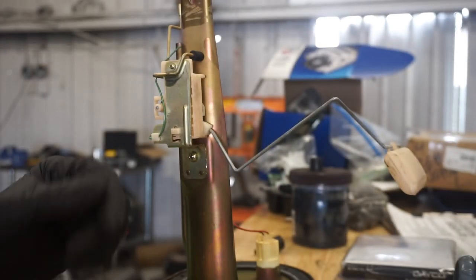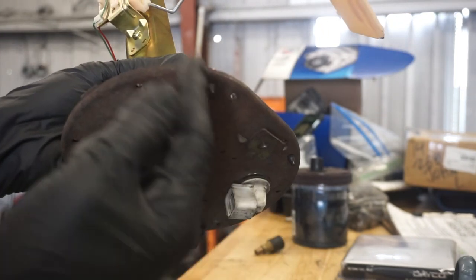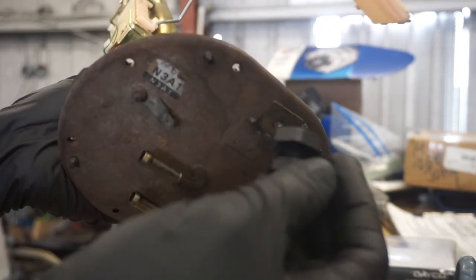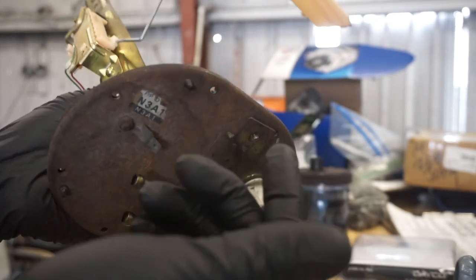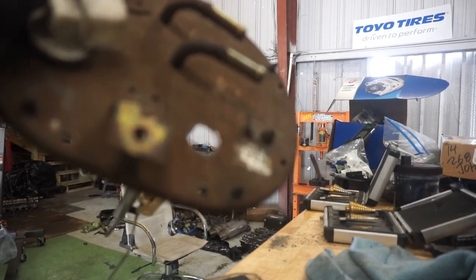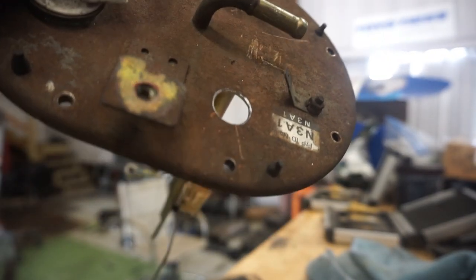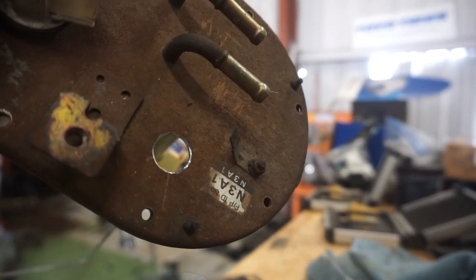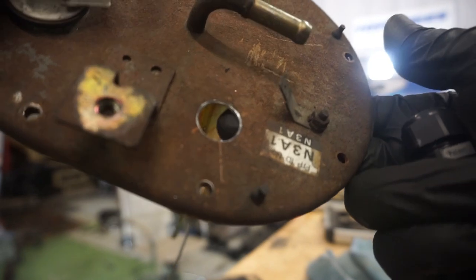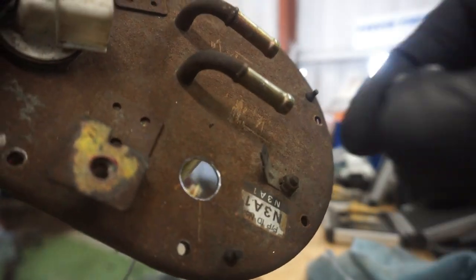Oh, and for ease of drilling, we just use a step drill to punch this hole out. It walks right through, and once we get to the right size, then we're good. We don't sit here and use regular drill bits and just run them up. So the hole drilled, according to the step drill, is a 5/8 hole, and then I used the Dremel just to clean it up a little bit. Put a taper on this side, cleaned up the burrs on this side, and then just walked it around a little bit just to clean it up some.